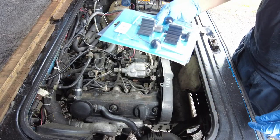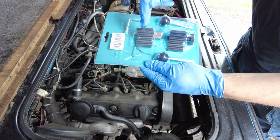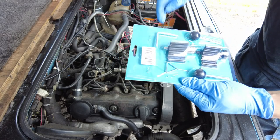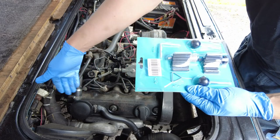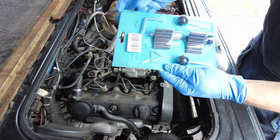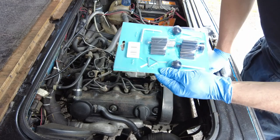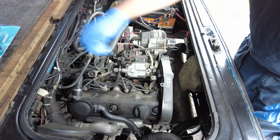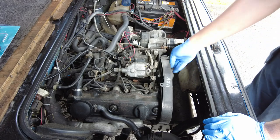So aside from the basic hand tools we're going to need to do this job, I also have this timing kit. We'll need one of these two and one of these pins, and I expected I was going to get a straight edge with it when I bought the kit but I didn't. We will need a straight edge or something for the end of the camshaft to keep that in place as well. First things first is to take off the auxiliary belt because we're going to need to take the timing cover off and we're going to need to take the bottom pulley off.